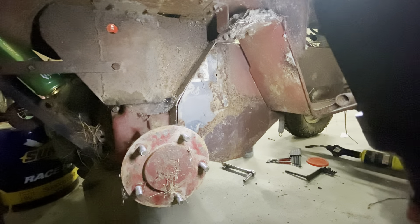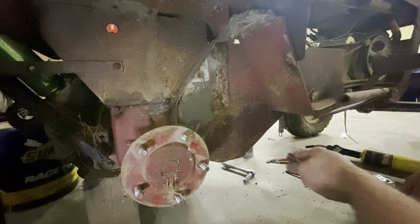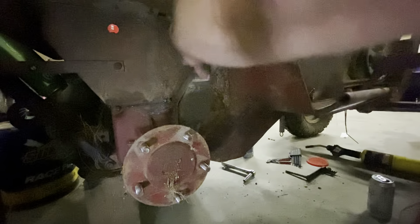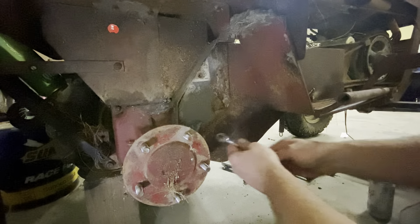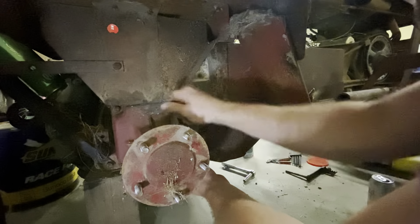It does make it a real pain to change out the belt — pros and cons. I need all the tools to take this off because these are seven-sixteenths. These didn't break off. These are some weird high-grade bolts — I got them from my dad's when I was working on this thing down there. I think these are grade 10s or something — he had a bunch left over from some pipeline projects where everything had to be super high-spec bolts and we got to keep the extras. This thing is also terrible to get all the bolts lined back up — you gotta start one bolt, then do that one, then this one. It's just all-around dumb.